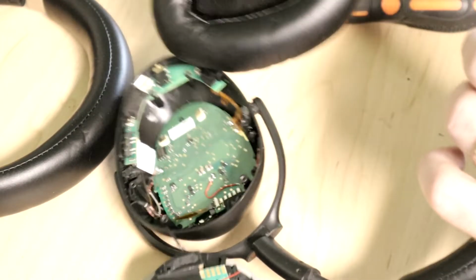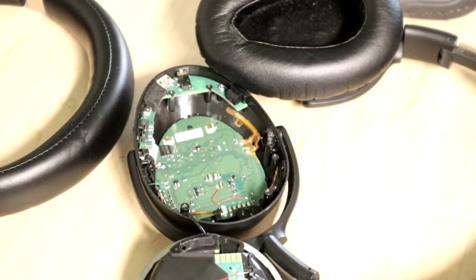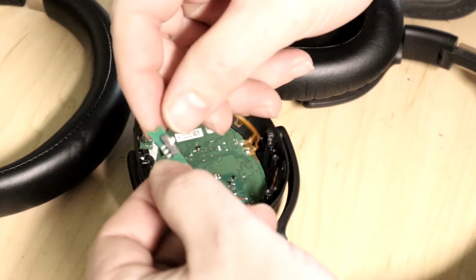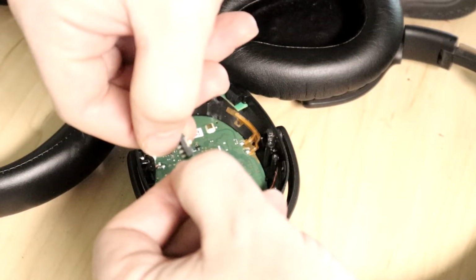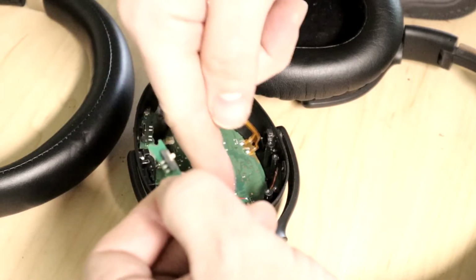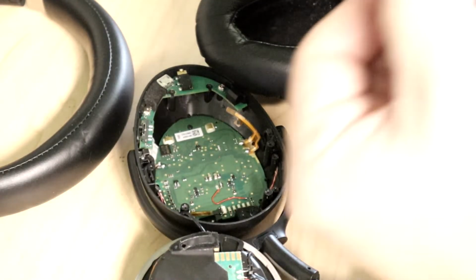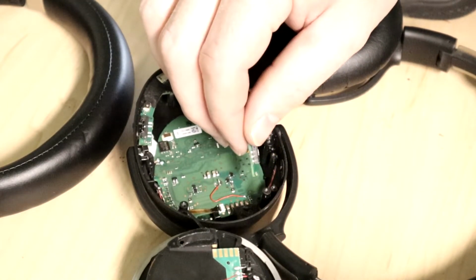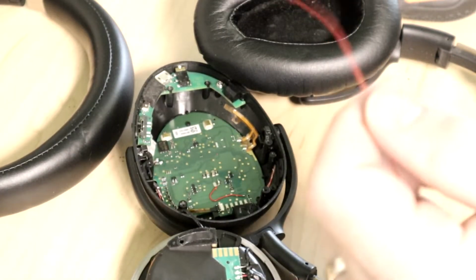So let me just get my switch back. See, instead of taking this thing off, I could have just literally, the middle pin was ground. I could have just gone positive to right there, or the other side of the magnet switch to right there, and in theory it should work. Now I'll just connect them to the back. Doesn't really matter. You can just do some small wire and connect them there so that they're less seen, but it makes for more wires that weren't needed.